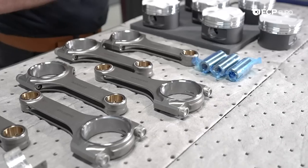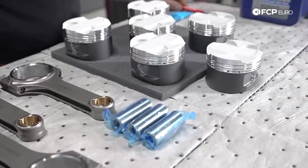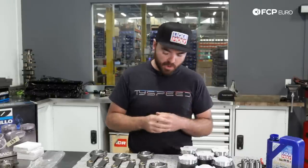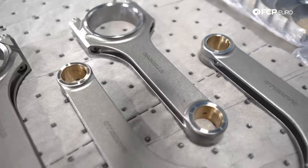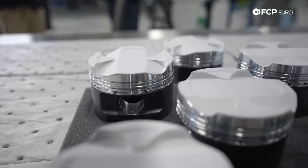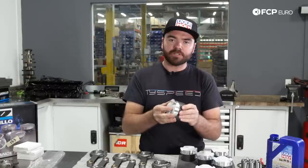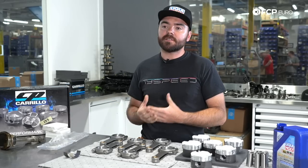What I have laid out here are our new billet rod and piston assemblies. We're going to be putting this together before the engine block comes back from the machine shop, to save time on the assembly process. We have Carrillo H-beam billet rods — much stronger than factory — and we're going to be using upgraded King coated engine bearings. I have a failed engine bearing from the motor we disassembled alongside a brand new one. We're also using CP pistons: coated pistons with a thermal dispersion coating on the top, a skirt coating on the side, and a slightly different compression ratio.